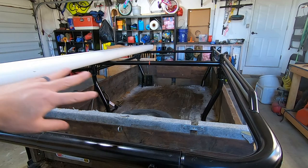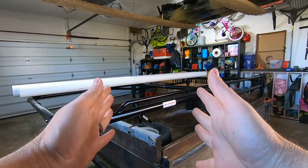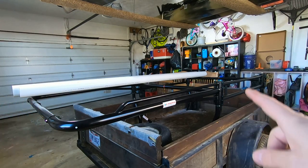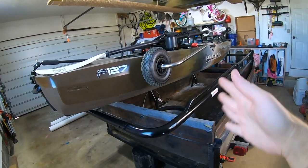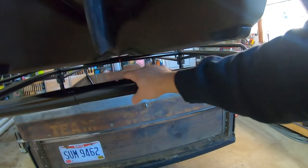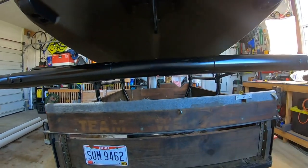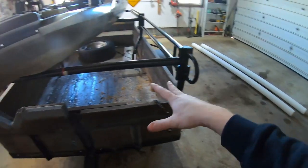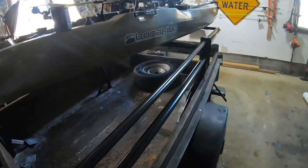I did the measurements before buying the 10-foot PVC, but make sure you measure — all ladder racks are different. This one was adjustable. To get the width right on the bunker bars, I brought my kayak down on top to do measurements with it on there. I had to turn it around and make sure it's spot-on center so I don't get any sway when moving down the road — measuring to make sure the center of the kayak is equidistant from both sides.